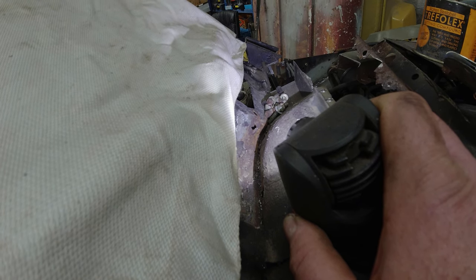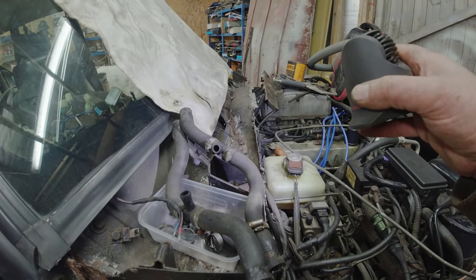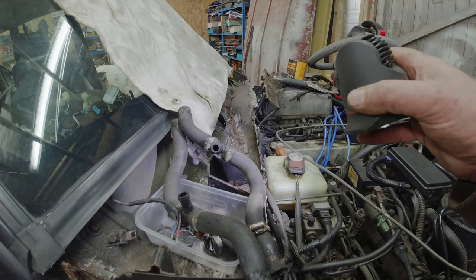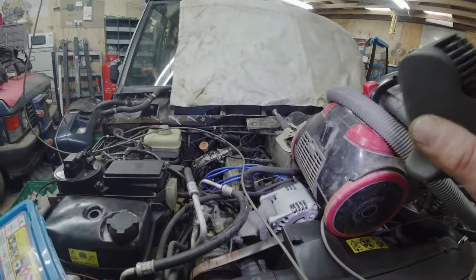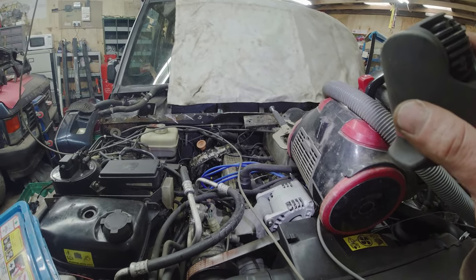It's not great, is it? So not only are you battling with rot along the top of the car, but you're also battling with your swimming pool in your bulkhead because of a design fault. Because all Land Rover had to do was drill a small hole in the forward face of that, and it wouldn't have been a swimming pool. It would have been a waterfall. Even attach pipes to it to take it down the back of the engine if you must, but I can't see that much moisture gets in there to cause that. Anyway,